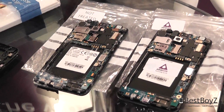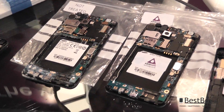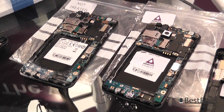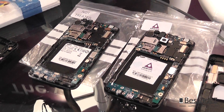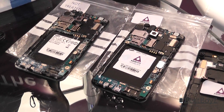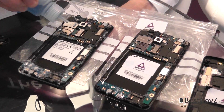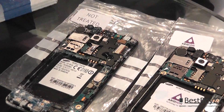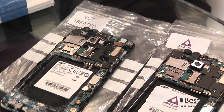Looking inside the device, both of these have gone through what's known in the industry as an accelerated corrosion test, which uses a salt fog spray. A salt fog will still get into the device at every nook and cranny, and certainly on waterproof devices where the O-ring seal has been compromised, this will still happen. On untreated devices where water is not repelled — just like the outside casing — the water spreads out and corrosion will occur.